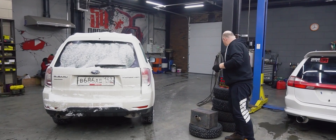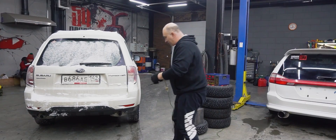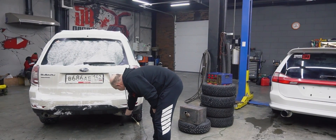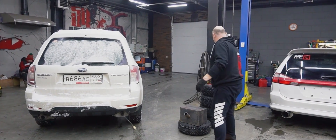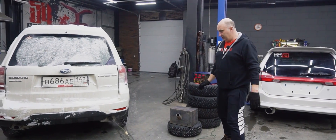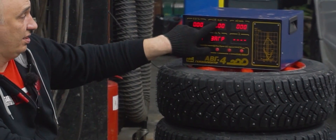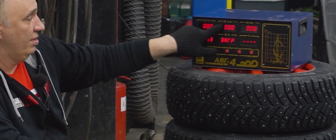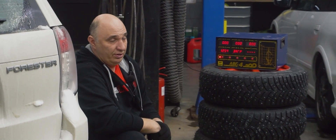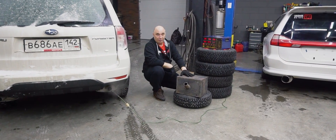And now for comparison, we've brought a car in from outside which is all frozen. Let's see what happens here. It is relatively new, so that's a good thing — we're just curious to see. Take a look at that: these figures are at zero, meaning there are no unburned remnants of fuel in the exhaust gases, which is good. The catalytic converters are doing their job and the engine is in good condition. Very nice — I guess it doesn't even need this.